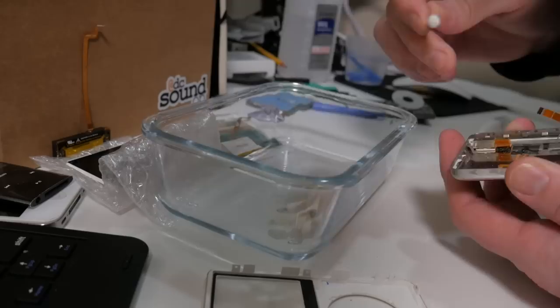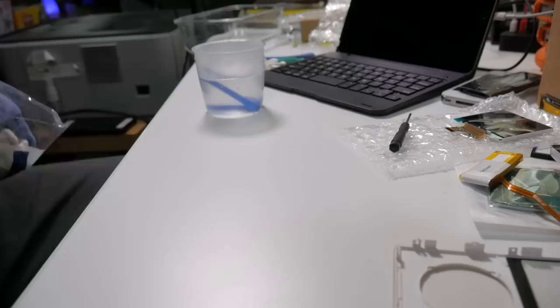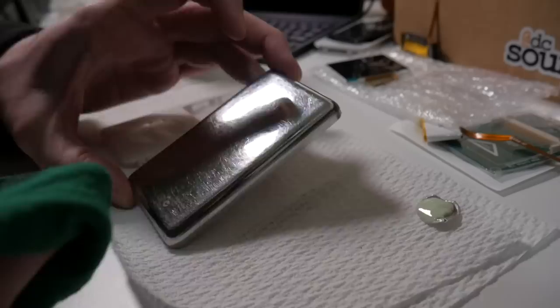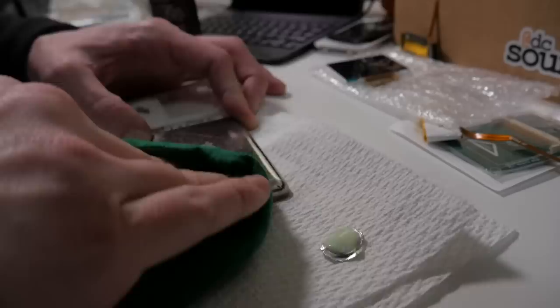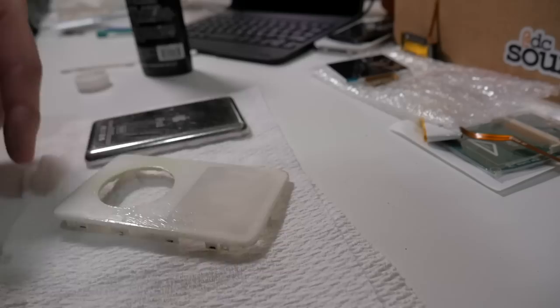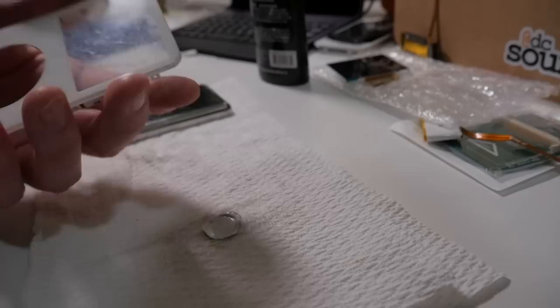The gummy rubber hard drive bumpers were the worst of the lot, so those are going to go into a nice warm soapy water solution with the other loose plastic parts. The rest of the components get a good cleaning with alcohol and some cotton buds. Next, I want to tackle the exterior while I have the electronics separated. I'm not sure what to expect from this polish, but I doubt it would be good for a printed circuit board. Applying it with a dry cloth and buffing it off — it's got a very distinct smell of raw metal while you're polishing, but it's not doing nearly the job that the Weiman stuff did in that video. It's starting to actually make the text on the back noticeably lighter, so it's time to stop. It honestly made the plastic worse too. That's a complete fail on the Flitz polish for iPod classics — I wouldn't suggest trying this polish at all.